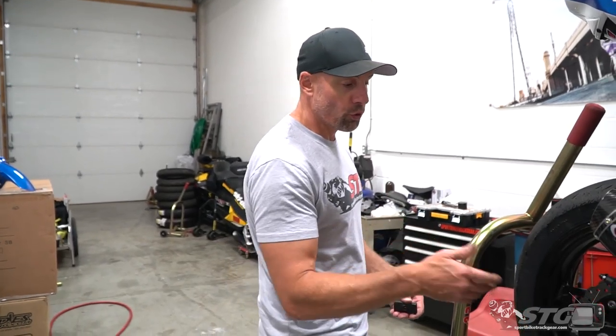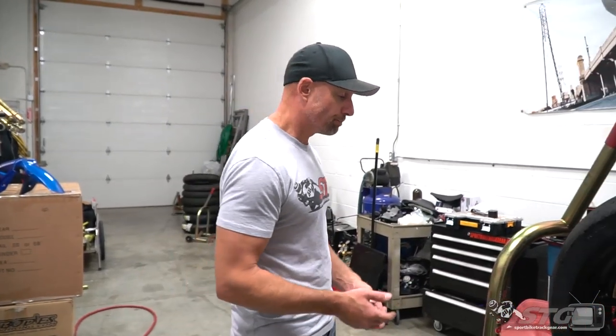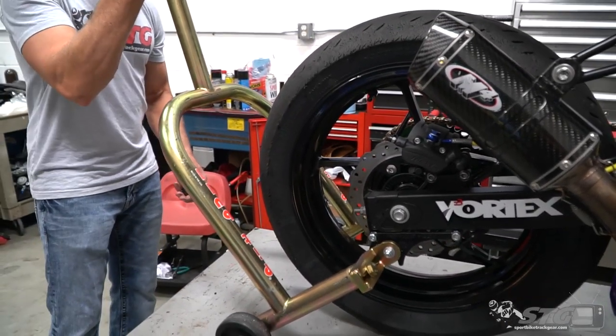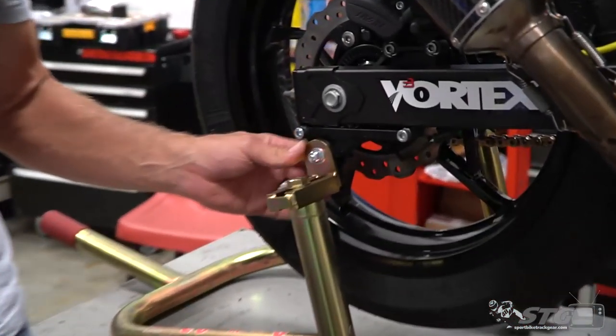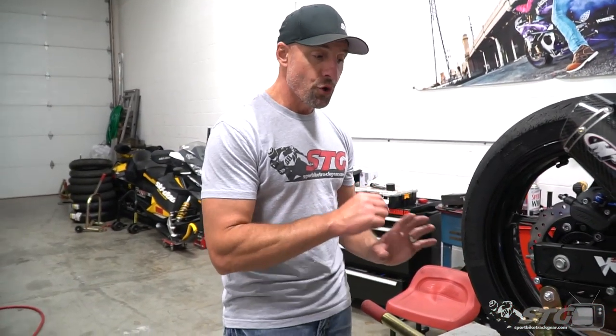I did cheat a little bit and used my Pitbull Pit Crew tire wedge, which helps to hold the rear wheel up in place when it's on the stand. It's a little harder to change the rear tire on the stand because you can't throw your foot underneath it to support and lift it. That Pitbull Pit Crew tire wedge is a really popular selling item — it just makes changing the wheel that much easier. You can't use a standard spool type rear stand; you need a GP style stand. The Pitbull one works fine, and I have a Woodcraft one that works with these as well.